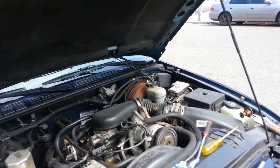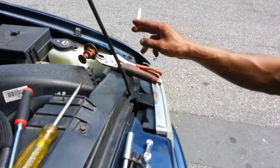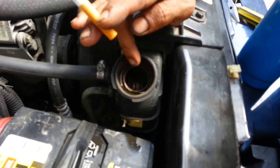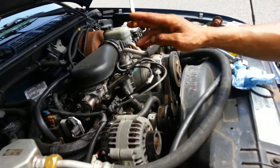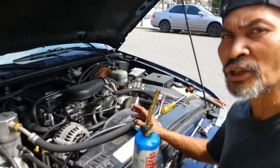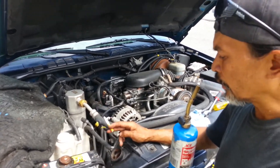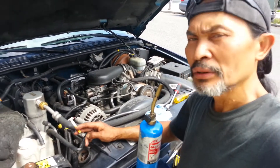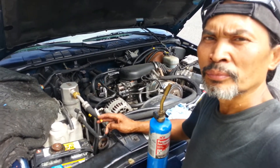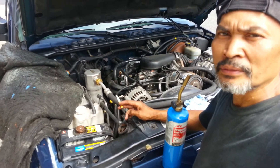This car is gonna be done today — put everything back together the way it's supposed to be. The thermostat tested bad and the radiator is all murked up with a lot of murky brown stuff — really nasty. The cap, everything, and the heater core too. Also inside the engine is rusty. The whole truck is getting completely flushed out. I'm going to flush it with the Prestone liquid, drain all this water out, put regular water in, warm up the car, drive it around a bit, come back, flush the whole thing out, put the hose in, and put in the new radiator fluid. The car should be fine and no more overheating.